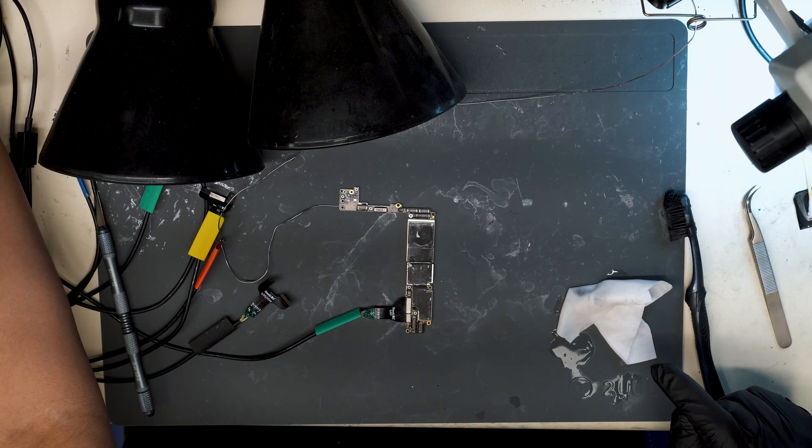We cleaned the bonding pads, replaced the chip, and that solved the VDD boost problem. But then we experienced a boot loop, which is normally a problem with an I2C line. Using a hint from the corrosion near U5000 speaker amp IC — beneath that chip we have I2C lines — we removed the chip and it was completely corroded; you couldn't even see half the pads. We cleaned it all up and the phone booted all the way to the passcode screen. There was no touch, so we disconnected J5800, which is a common issue on the 8 and 8 Plus — if touch isn't working, disconnect that connector and it'll start working. The phone is fully booting, we have a path to data, and we can call the customer. Thanks for watching.